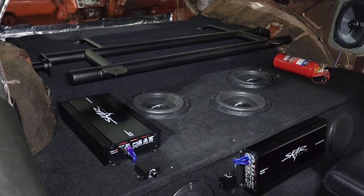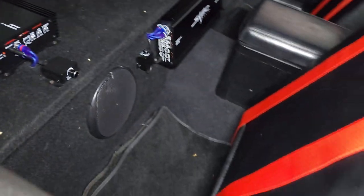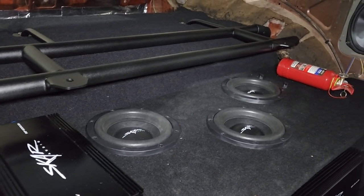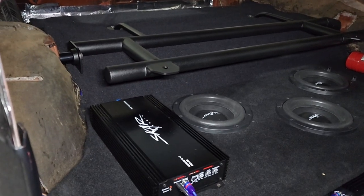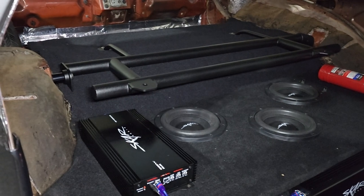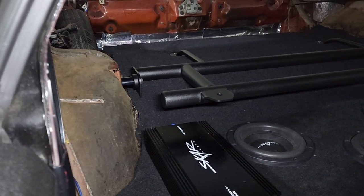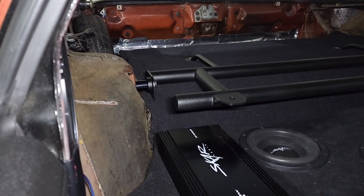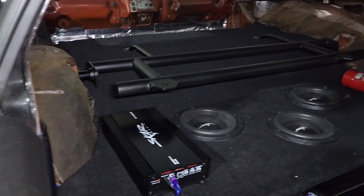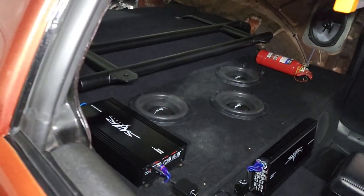That's it as far as the install — don't mind the mess, I haven't put everything back together. The harnesses from the bottom of the seat will just get bolted in here; I'm not going to do that until I get it welded in over there and get the interior put back in. Keep in mind when you guys are doing this — if you go this route, you need to put the two side plastic pieces in because they have a hole located on them that the spacer is going to sit in. I have mine off because of that and some other things I was doing.